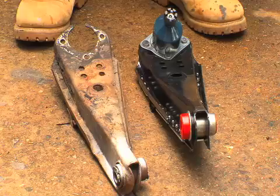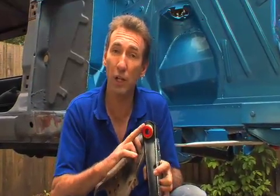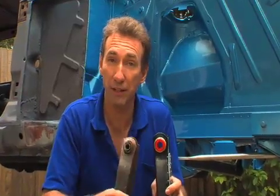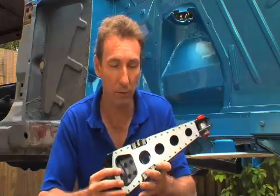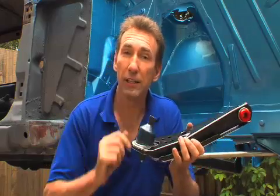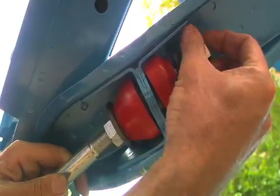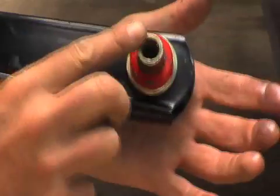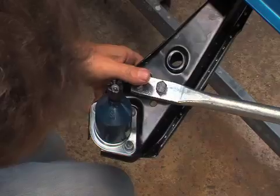The same goes for the lower control arm. You could use the old one but why would you? RRS's redesigned lower control arm has an oversized bushing, more surface area and a better pressed fit. It's made from thicker gauge steel and has a reinforcement plate for extra torsional rigidity. Then there's the ball joint — I'll let Matthew explain that later. So with the indicator facing down and the nuts on the tie rod fitted loosely, grease and install the lower control arm bolt, followed by the two 7/16 high tensile nut and bolts which connect the front strut rod to the lower control arm.